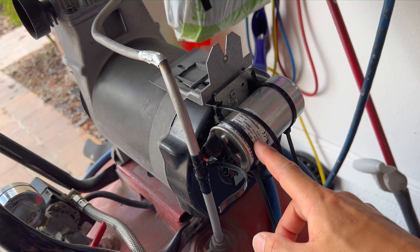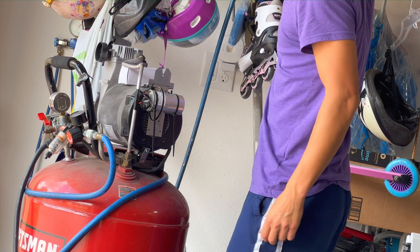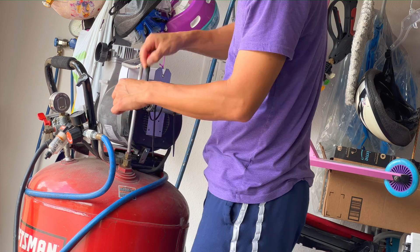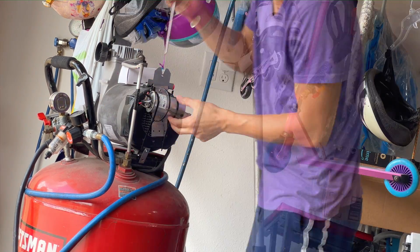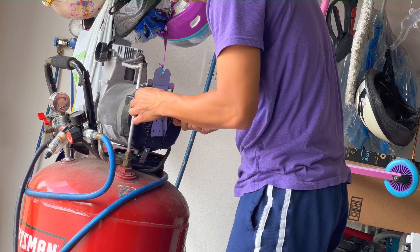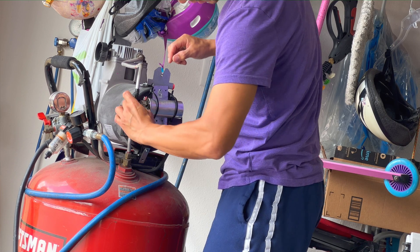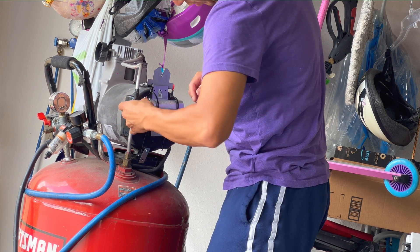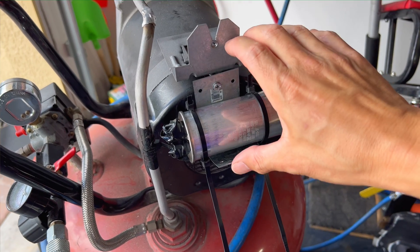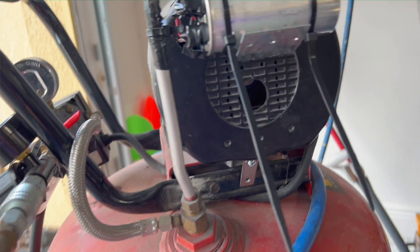Now that the capacitor is on the outside, I don't need to take anything apart. I just need to unbolt it from the zip ties and change the plugs. Always want to discharge a capacitor by shorting the two sides with a screwdriver to get rid of any stored charge. Make sure your compressor is unplugged. The reds go on one side, brown goes on the other. Tape everything up, secure with zip ties to keep things from shorting out. I bent the bracket up to expose the air vent hole I'd cut out before, then put the cover back on.